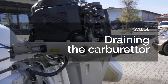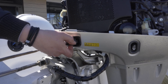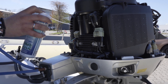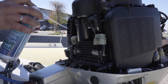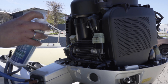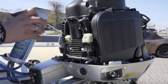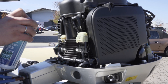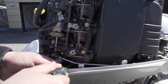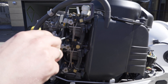Using a preservative protects the carburetor and cylinder walls from flash rust and corrosion. To drain the outboard completely, pull out the fuel plug just before the end of the test run. Just before the engine stalls, spray the internal preservative into the intake tract to allow it to settle in the carburetor and combustion chambers. Keep spraying until the outboard cuts out. Finally, the remaining fuel must be removed from the carburetor by loosening the drain plugs and then tightening them again.